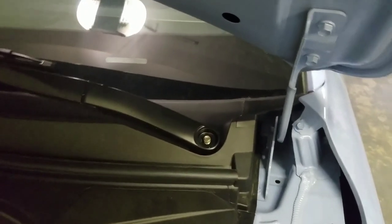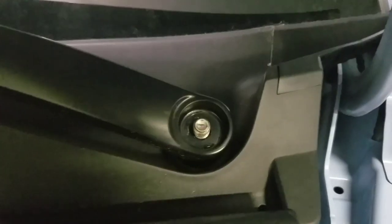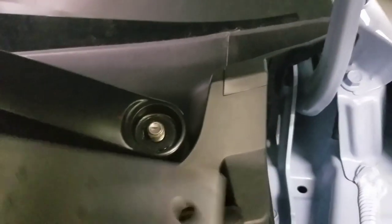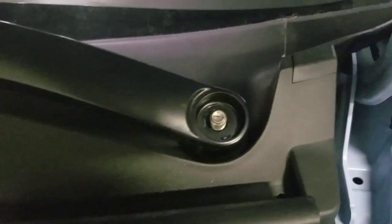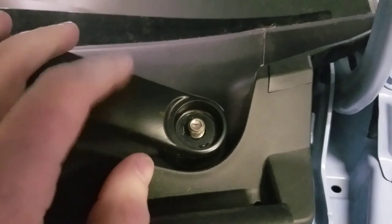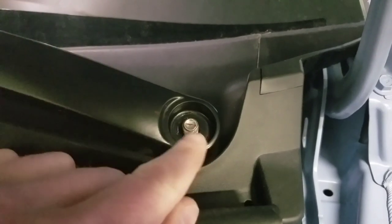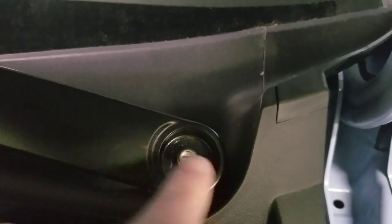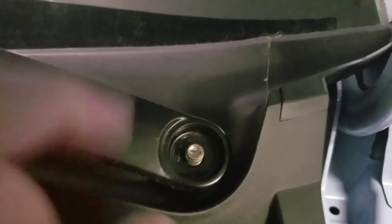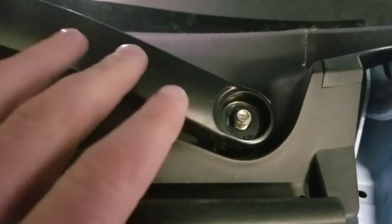So if you really want to make sure that you get this in the right spot, along with the tape - the tape will work. But if you get too nervous, what you can do is just get a ruler or something and mark a straight line so that it's lined up. Because this is on a gear type - you'll see it when I pull this off, there's like gears. So you can just go ahead and mark with a marker a straight line so that when you put it back on, there are no questions asked - you have it lined up exactly where it needs to go.